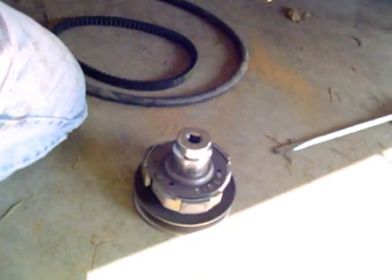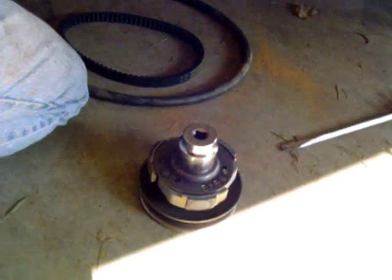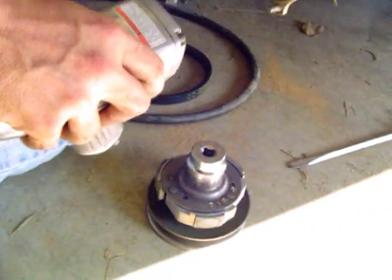I use a one-and-a-half inch socket to fit that big nut right there. We're going to blast — very lightly on this — these are very fine threads on that nut and we don't want to break them. In addition, this is very spring-loaded, so what I do is I put my feet on each side of it, blast it, and then slowly let it off.